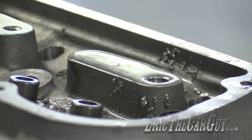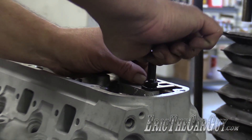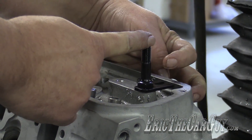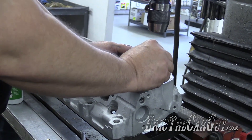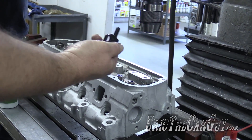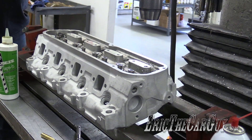That's a brake line there, and this is a pushrod guide for those of you playing at home. Why would we use pushrod guides? We need something to keep the rocker arm aligned with the tip of the valve, and the guide plate will keep the push rod from walking around since everything pivots off the stud. That could be particularly disastrous with roller rockers. That's an advantage of a shaft rocker setup — the shaft goes through every rocker arm keeping everything aligned properly, and all you have to do is shim it side to side. Chryslers and the FE series Fords use shaft rockers, and you can get aftermarket shaft rocker sets. They hold up better under RPM as opposed to studs.